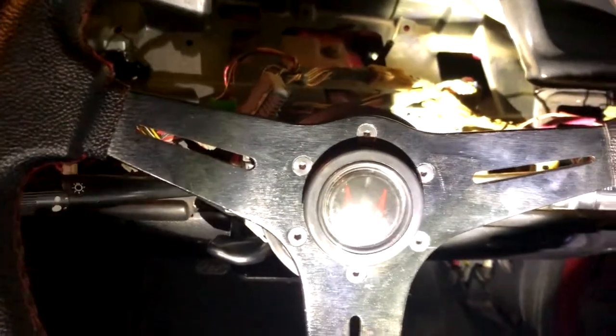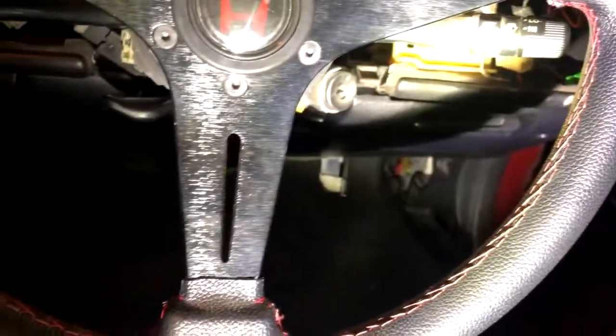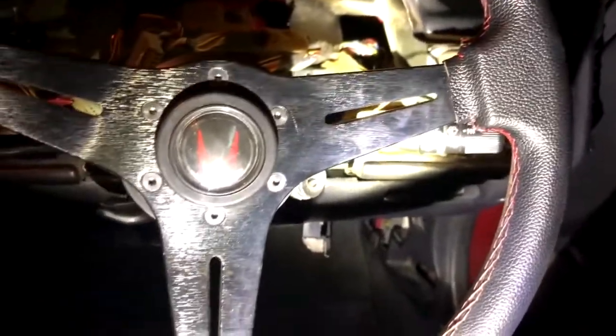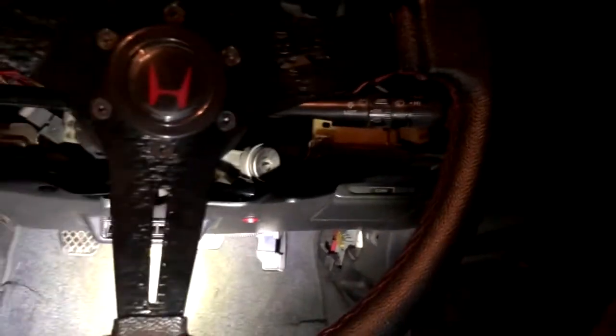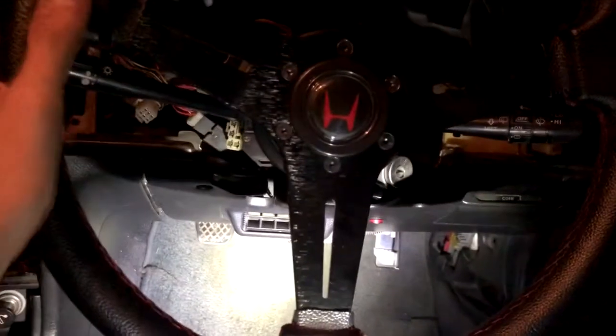I also didn't have turn signals, so I diagnosed that using the hazards. Basically, I found a fuse down there, I forget exactly what it is, basically the gauge and cluster fuse that's also connected to the clock, and I think the stereo too. Anyway, it's connected to the clock for sure. There was a 30 on there, and it's supposed to have a 7.5. So I swapped it for a 7.5, and I had working turn signals as well as a working clock. That solved basically all my issues except for the dash.